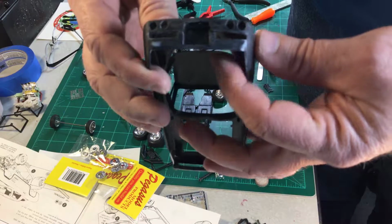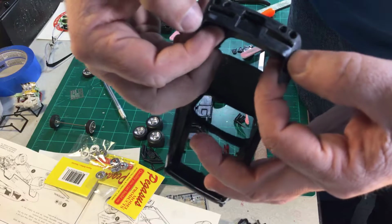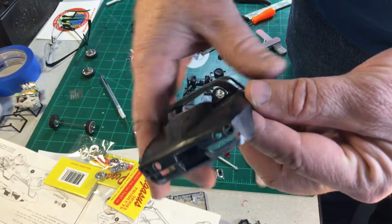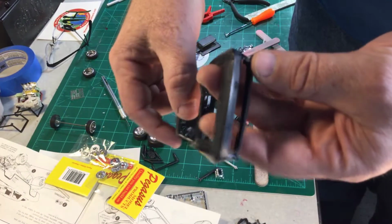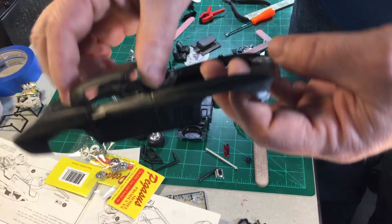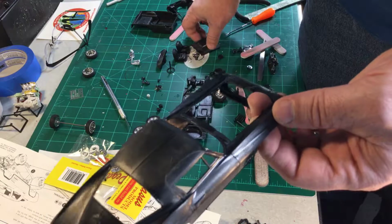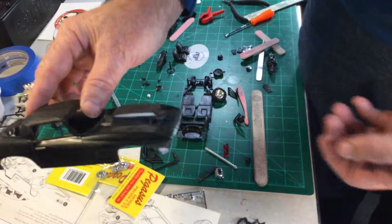Again, here's the back tail piece that we've been working on. As you can see, there's no more lines there. It's all molded together. Molded together nice. Seam is gone. You don't have to see that anymore, which is something I like. I like clean lines on my cars. And hopefully, with just a little bit of wash, I'll hit this one more time with 800 grit wet dry sandpaper, and then we'll do a wash job on it. And hopefully tomorrow we'll be able to throw a video up of going into its first coat of primer, so you guys can see what she looks like together.